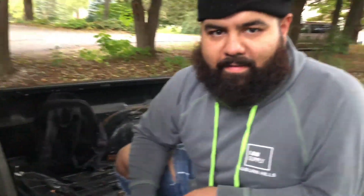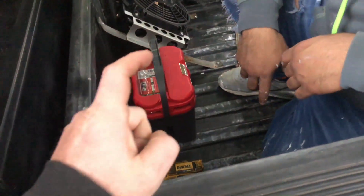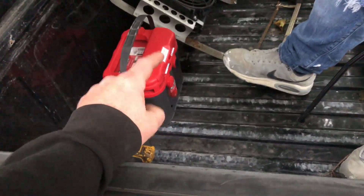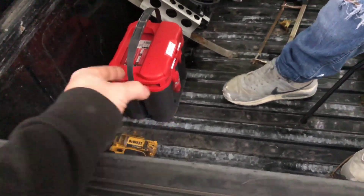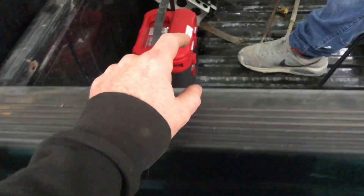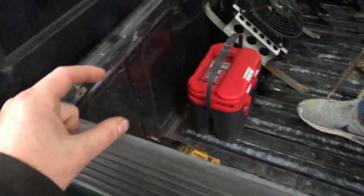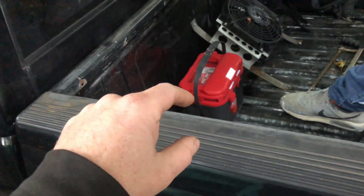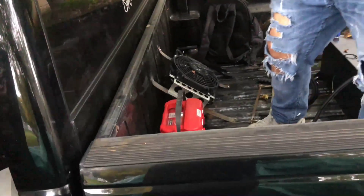It's pretty awesome. So we're going to run his negative cable to this switch, and then the other post on the switch we're going to run to ground. For those of you that want to run a kill switch, the negative is definitely the best way. If you try to do it on the positive, it's not safe — if you turn the switch off with the negative connected, you don't have ground for the battery, so you don't have power. However, if you do it with the positive cable and there's some kind of mess up, the battery is still grounded, which will give it power. So it's better to do it with the ground. That's my two cents on that.